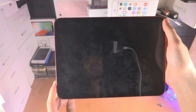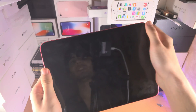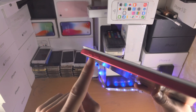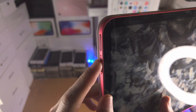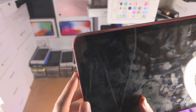I'm going to show the key combination first, then let's do it together so you can have 100% success. The key combination is as follows: we're going to click and release volume up, then click and release volume down, and then click and hold the power button, keeping it held down until we see the Apple logo.